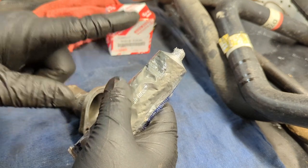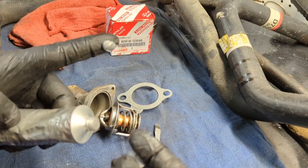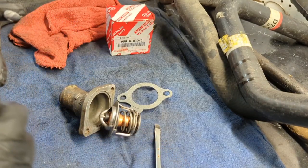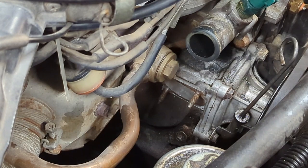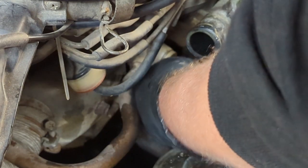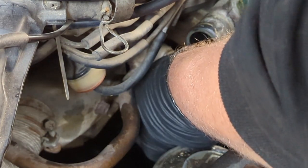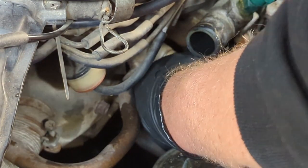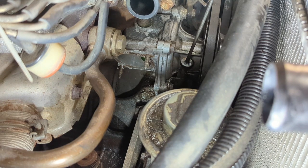Remember this stuff has a cure time so we can't immediately fill it with coolant and hope for the best. I'm going to show you a trick to make sure it's not leaking. Taking a really thin layer of RTV and layering it on the outside, then shoving the gasket on and bolting it in place. I'll put a light layer around the perimeter because the surface isn't 100% smooth anymore — it's old, aluminum, a bit pitted, plus there may be remnants of old gasket.